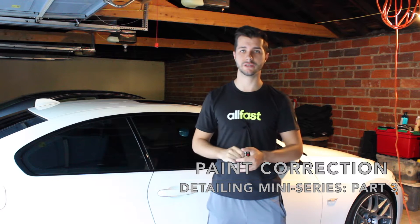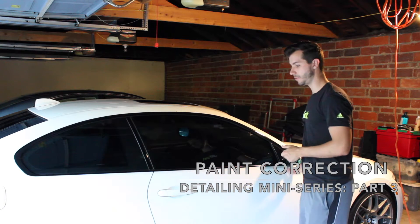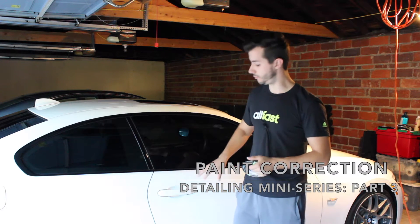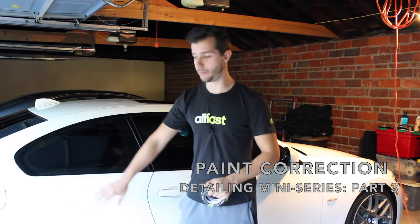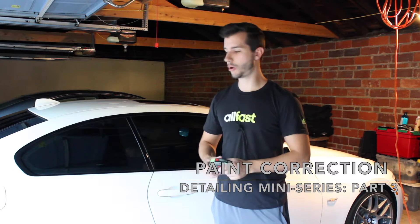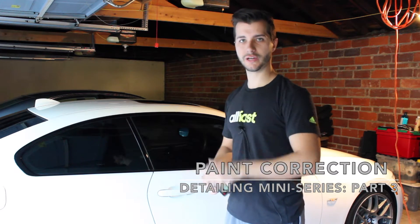The first step of part three is masking off any areas that you don't want to bump with a buffer or nick. So areas to protect include the trim, the bottom of the mirrors, around the door handles — because as the random orbital polisher comes through it has a little throw to it. Some people tape the top of the tires. I'll also do some of the door seams so the corrective polish doesn't get in the cracks and make it harder to clean.